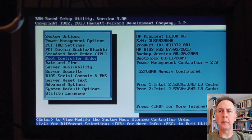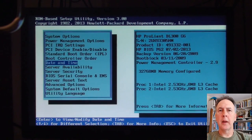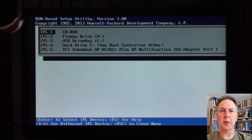Most of my settings are already good in here. I want standard boot order. See how I'm looking for a few devices before I go to the hard drive? You want to do that at least when trying to install a new operating system. Otherwise, if your hard drive is above any of those, you're going to boot into the hard drive first and never install the new operating system. Mine's already set up, so we're just going to escape out of here.